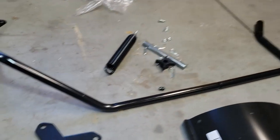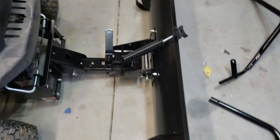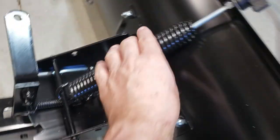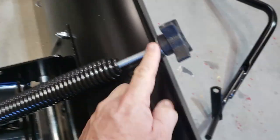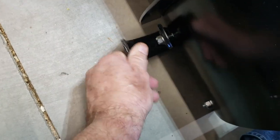Here's the whole madness for the snow blade — they don't tell you how to hook it up or which angle the bar goes. Here's what we're left with: I figured out the long bar goes across the big hole, this little connector hooks up here with the tension handle, and down here are the height stops. They have nylon screws, which are easy to work with in wintertime.